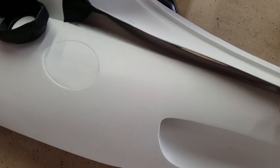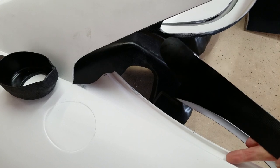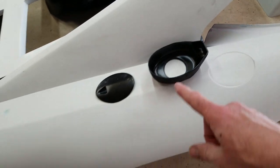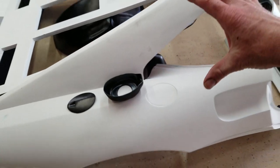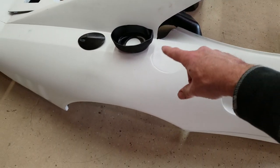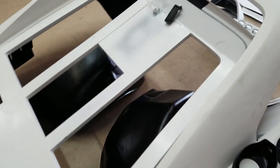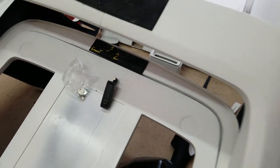Here's the entire rear end. You'll see it's duplicated that little edge where the window sits — it's duplicated there — so this edge would go up against there. Cut this piece right there, cut that away, put that piece in, but this just gives you a little bit of guiding. There's the bucket. We don't cut this out because it leaves a little weak place right here when you're lifting this whole piece up — it can crack there. You've got to be kind of careful. I would put this whole rear clip on first, then cut that out, then get your cup and put it up from underneath.